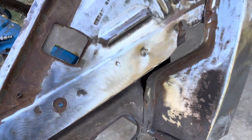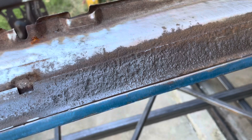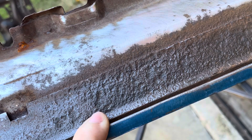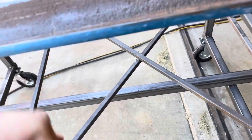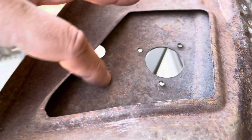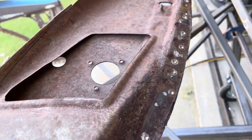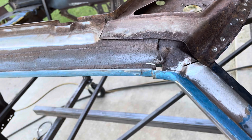I've just taken this wheel and went over and kind of cleaned up, and I still got a long ways to go. You can see here this is an area I'm likely not going to get clean without sandblasting it, so I won't use acid up here — I'll have to sandblast that clean and see if it works. I'm also a little OCD, so I may end up taking this off and cleaning it because the rust has gotten underneath there too. I mean, where do you stop? I've got rust in here, I can blast in there, but there may be rust under here. Do I take this thing completely apart, or do I just spray acid in there and hope it kills all the rust?